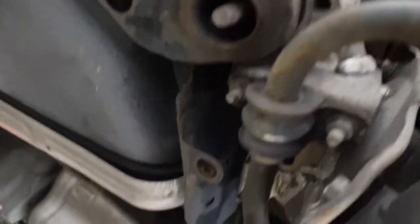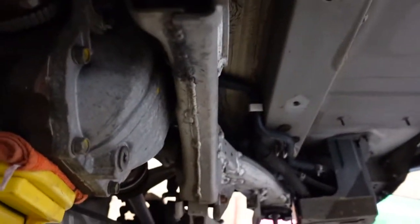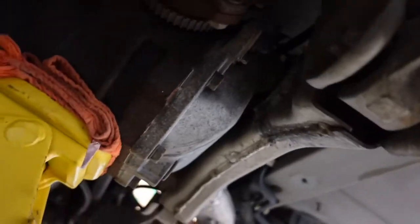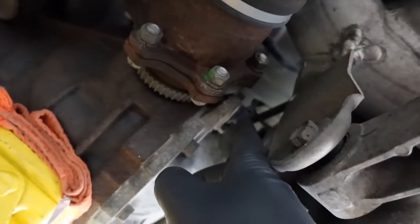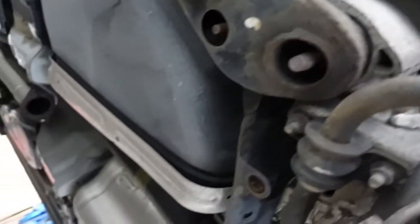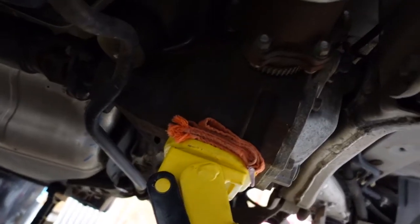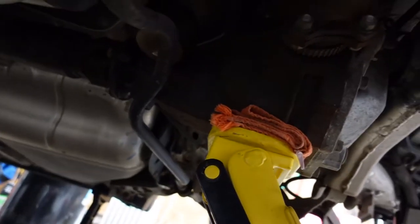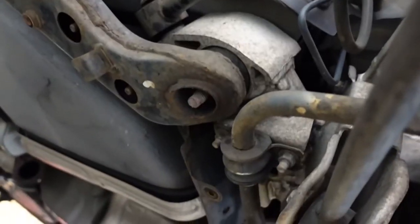Just be careful — you have some electrical connections, like wheel speed sensors and your brake lines. When we remove this, just be careful that it doesn't drop down too much, too fast, so we don't damage anything. We're going to get these off on both sides, and I think that should be everything needed to lower it down enough to get the collars in.